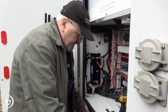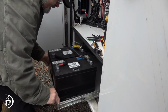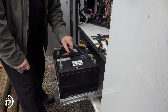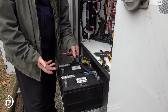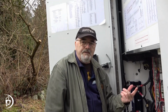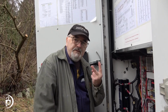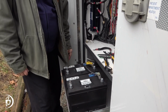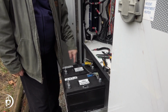and I've also disconnected some of the power controls for this battery. So this is the positive of these, I think, lithium ion batteries, but they're only 25 amps, which is not enough to power this the way we want it. We're putting in 170 amp hour batteries, lithium iron phosphate, 2 of them. And the unfortunate thing is that they're about an inch taller than these ones, so I'm not even sure I can get this into this container.